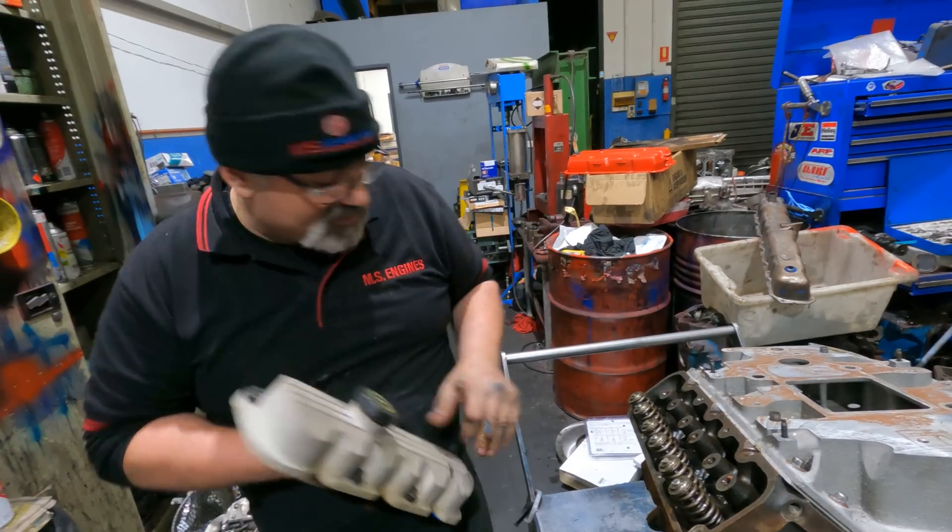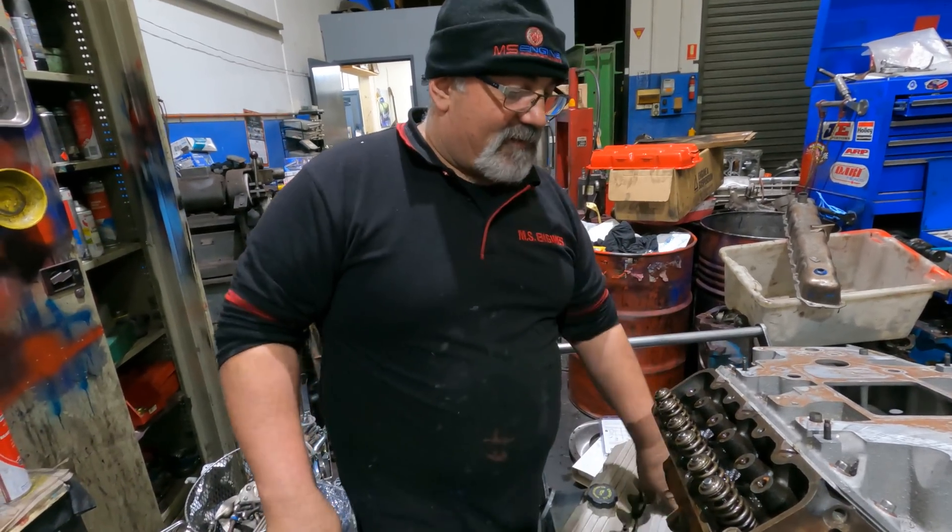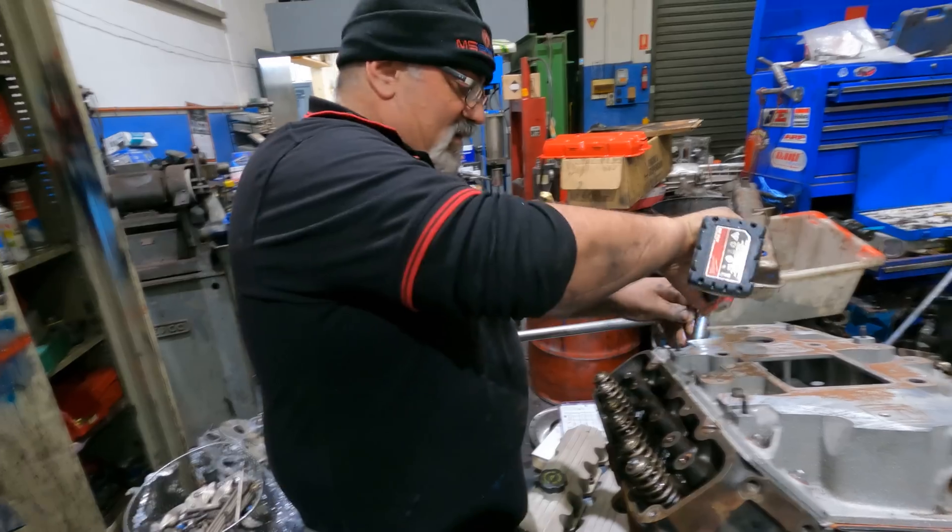So they made the rocker covers different — otherwise it'd be straight. The factory heads — the normal ones — had the provision there for the hole, but they never had it machined out. So you can actually get normal heads and redo that if you had to. Springs, valves, caps, collets — all the same. The heads are basically the same. Rocker covers are different, balance shaft is different, conrods are different, and the pistons are different. Everything else is the same.